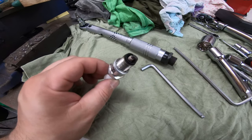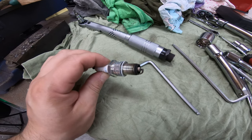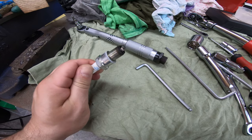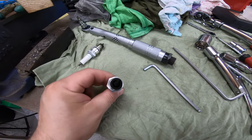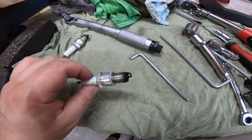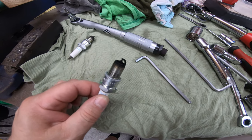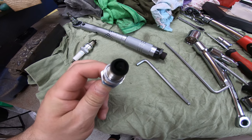I had a look on the front cylinder, which was running fine, and as you can see it is perfect - the spark plug is bang on, beautiful, nice light brown, as it should be. And here is the rear - first I'm gonna have a look at the float level to make sure the amount of fuel in the carburettor is what it should be, but that's rich as hell.